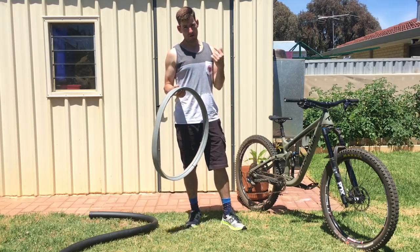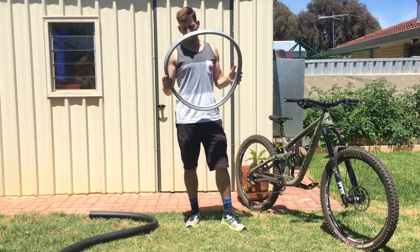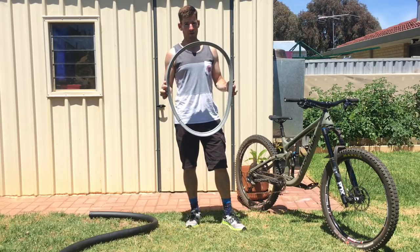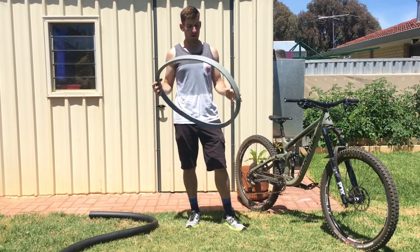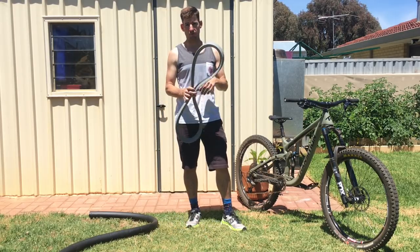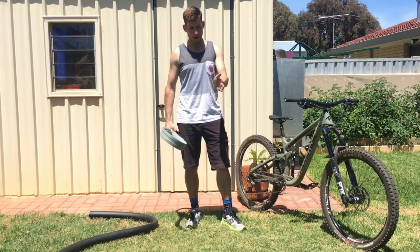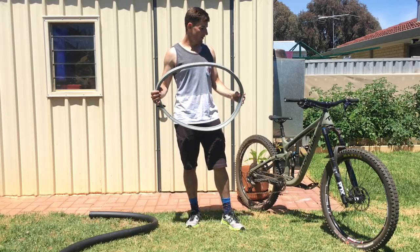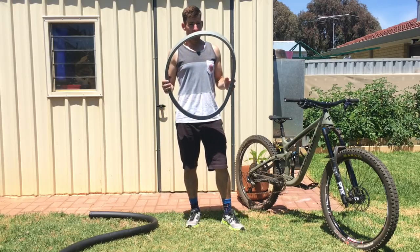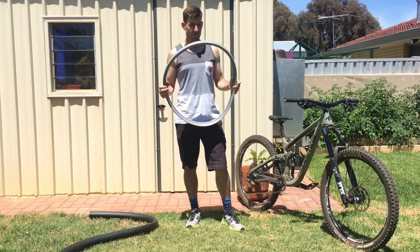So I got to the bottom, checked the pressure, 9 psi. I've done a video about it, but it felt so good to ride on with that almost zero pressure. I just felt happy that I was safe and I could get down from the top of the trail all the way to the bottom on a real rocky track and not feel like the back end's fishtailing. It definitely held that tyre in place well. So definitely reduces squirm when you've got a flat or when you're close to flat.